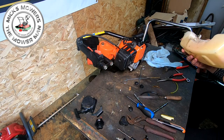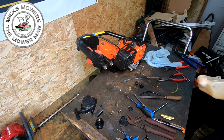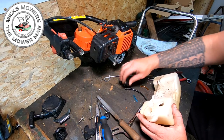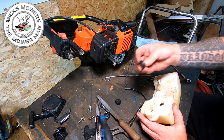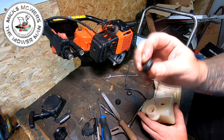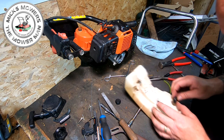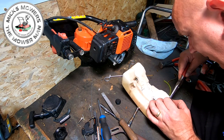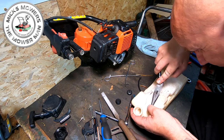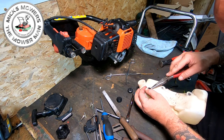Right, so there's the tank. Let's have a little look in there — there's a bit of gunk in there, not a lot, but there's a bit of gunk up the top end here. That's what I want to get out. Let's get the new grommet in place first. So now we're back on the bench — hopefully I've got a grommet to fit this. I've got these two, and I've got quite a thick neck on there to get past. I think that's going to be the better choice because it's got a slightly thicker neck. So the idea is to force this one into place — it should go over. It's going to be literally brute force to squeeze that in.